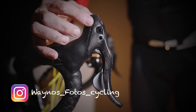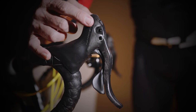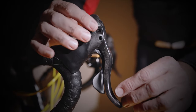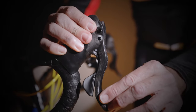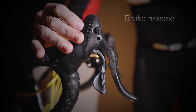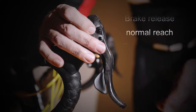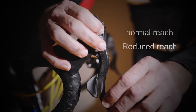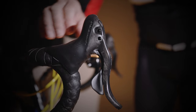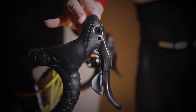The adjustment for the brake lever not only releases the brakes, it actually gives you a reduced reach. You can push it across three positions: the released position is your brake release, one click in is your normal reach, and one more click in is your reduced reach for smaller hands. I actually have big hands but I like this reduced position — I find it more comfortable.